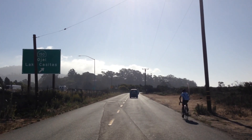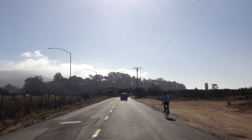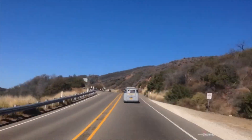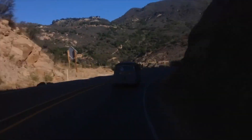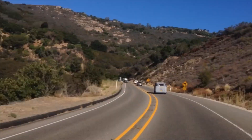After that we took off and moved to Solvang. I'm happy to report that the Samba did great going up the hills. I was pulling 400 amps continuously for about 20 minutes going up a seven-degree grade mountain, like nothing. The low-end torque on the motor is great — it just pushes and keeps going on forever.